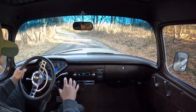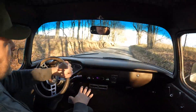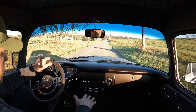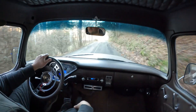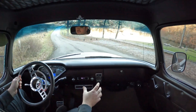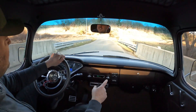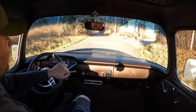Another small thing is the pedal location — stuff you might not think of when building a truck. How your foot fits in the truck is very important. If my foot were comfortably resting on the floor, I could swipe right under the gas pedal. The pedals need to come down, and the brake pedal needs to come down and back a bit to fit comfortably. In terms of engine management for a truck like this, I think it's best to stick with the stock ECU. This is a complete pullout, so the harness comes right out of the truck — we'll go with an aftermarket company for a new harness but keep the stock ECU for drivability, and you can still tune it for the cam.